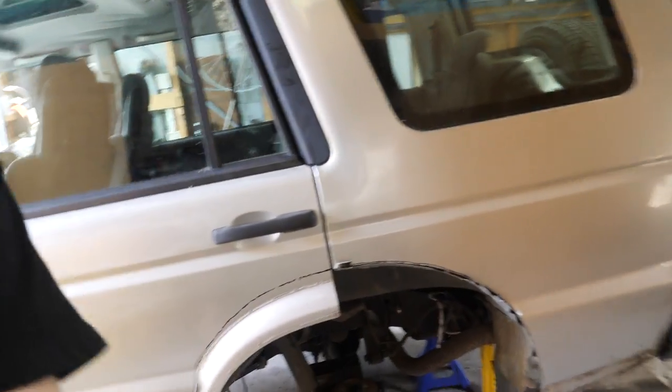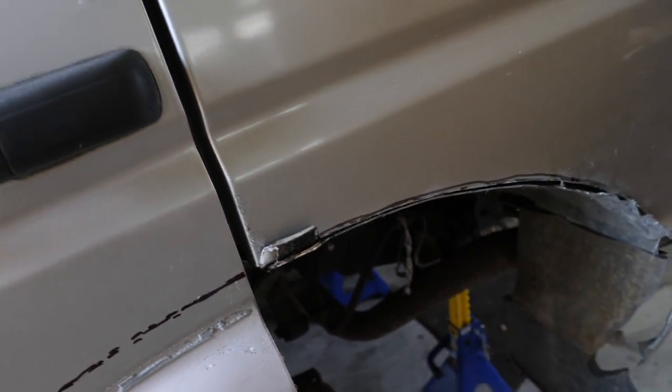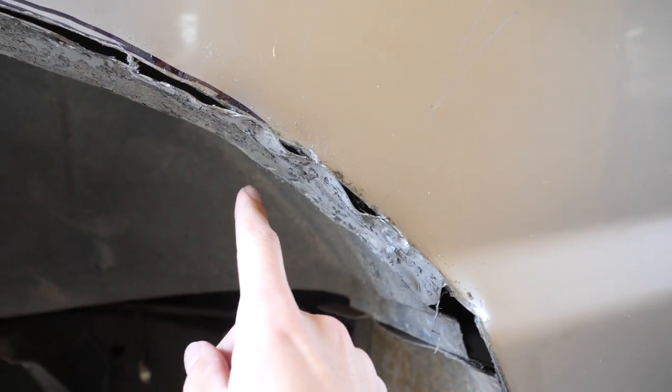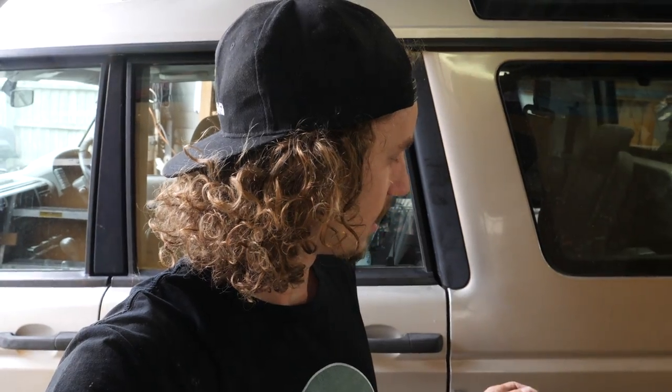It's a new day now, and especially after telling you guys to double check before you cut things, I went and messed up, guys. So I was meant to leave some material out here so I could fold up a flange that we could then rivet. So what did I go and do? Just sailed right through and chopped it all off, not thinking, and left me in a little bit of a sticky situation. So I've come up with a new game plan. I'm going to cut a couple of wee L brackets, which I can put inside here that will go like that. Bit hard to explain, but you'll see it once I get going. But before I do that, I need to cut the remaining excess off, clean it all up, make it look presentable, and then I'll cut some brackets and rivet them in.